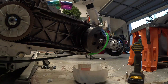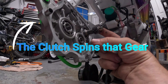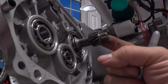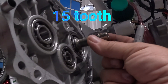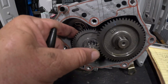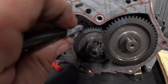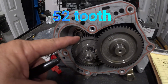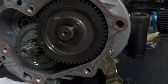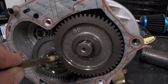I'm going to help you make sense of it all — it's not that complicated. There are actually four gears in this transmission. This is your input shaft — what they call the primary drive gears. The primary has two gears, the secondary has two gears, and those make up your final drive, which is the rear wheel turning. The input shaft on the primary set is always 15 teeth. The primary gear spins this big gear — some call it the idler gear — but think of that big gear and the little 15-tooth one as one set, your primary set.